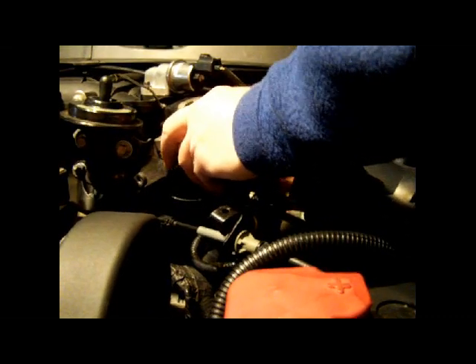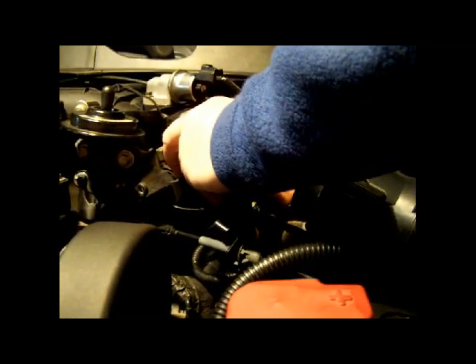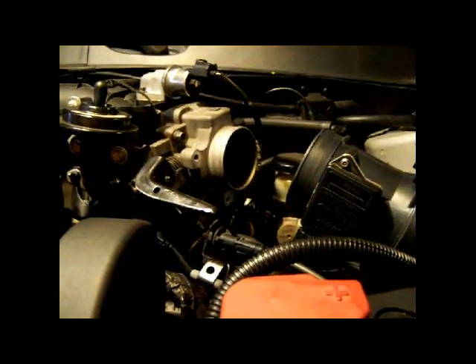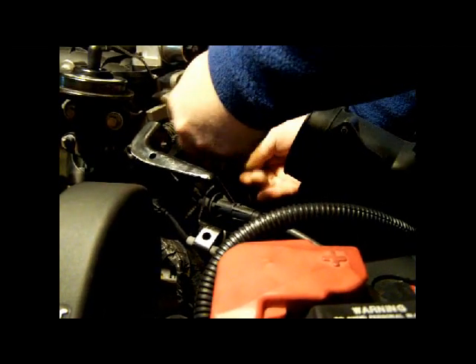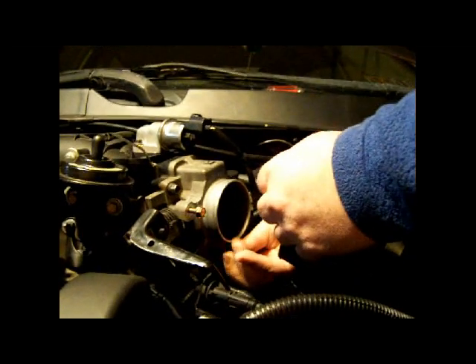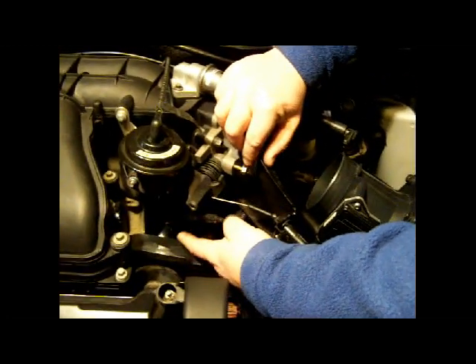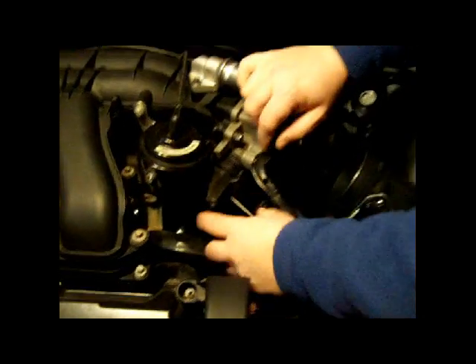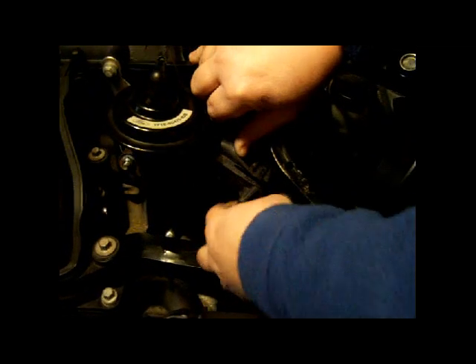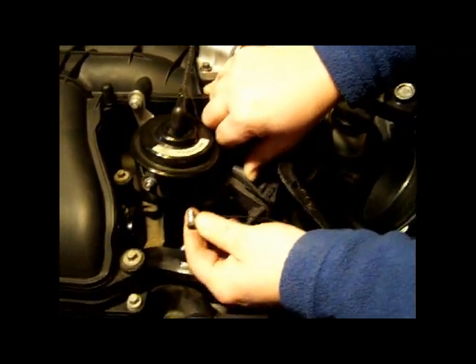A nice tip I picked up from the internet: when you take something apart like this, once you're clear, just put the bolts back in the hole and screw them in a little bit. That way you won't get your parts mixed up and you have less chance of losing them. Now I've freed this adapter and I'm going to disconnect these other two pieces. The first thing is just a pressure fitting for the speed control — push it away from the little knob and it comes off. For the throttle cable, turn the throttle plate and then take the cable out of its slot around the back, and it'll pop out of the slide. Now that whole assembly is free.